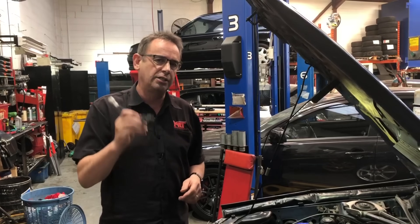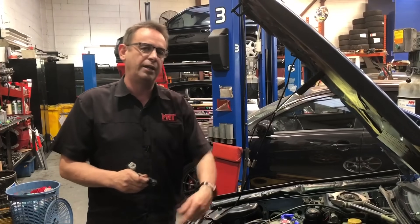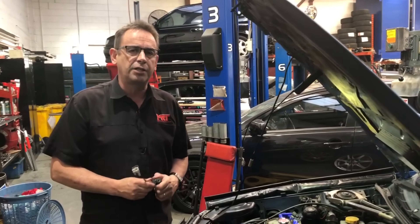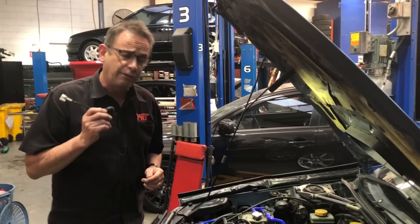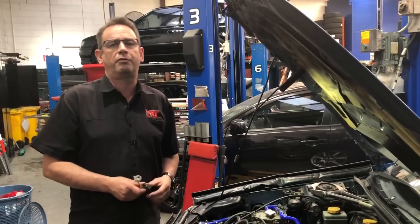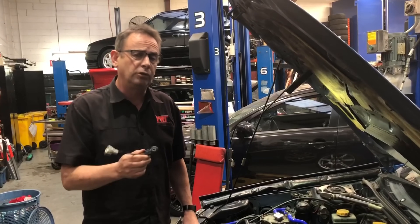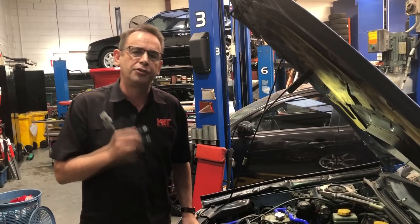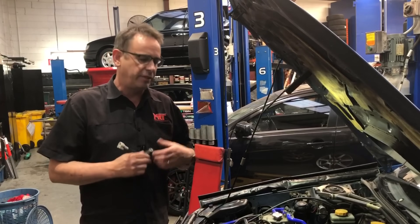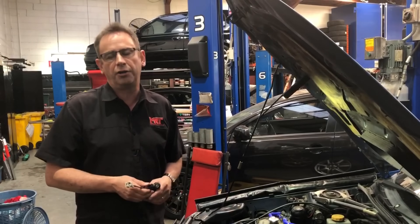Make sure you check your knock sensor. If you've got a fault code on the dash, don't assume you know what it is. You may have scanned it a couple of months ago, but you may have another fault code you don't realize is there — you could actually have two fault codes. So regularly scan your fault codes and check to make sure you know what they are. Get the fault code number; if you need to know what it is, you can look it up on the internet or contact us through our partner networks around Australia for more technical support. Make sure you analyze what the code is and don't just go buy the part to replace it. Use common sense diagnostics, think outside the square, and don't just replace parts for the sake of it — think about the code and the fault first.